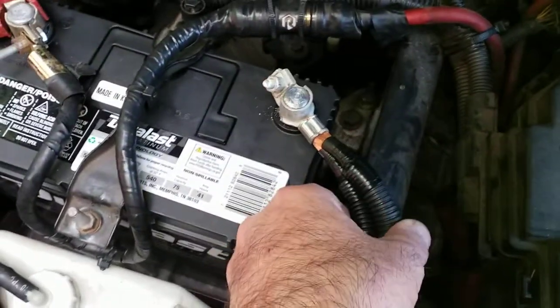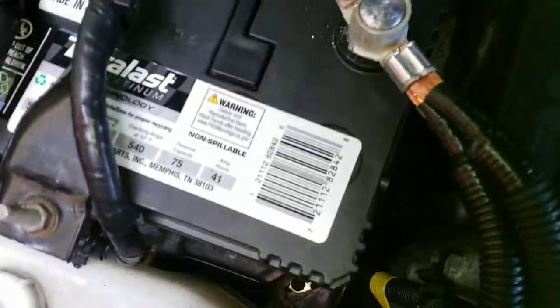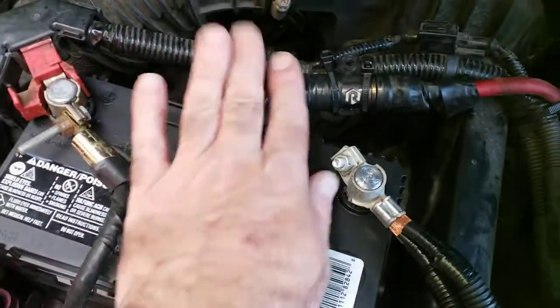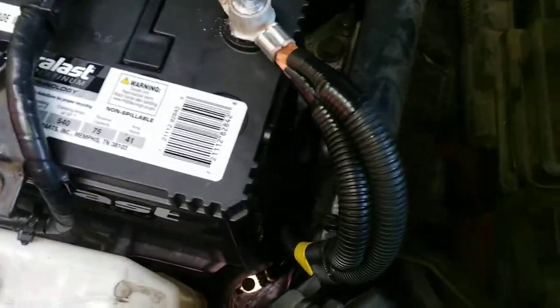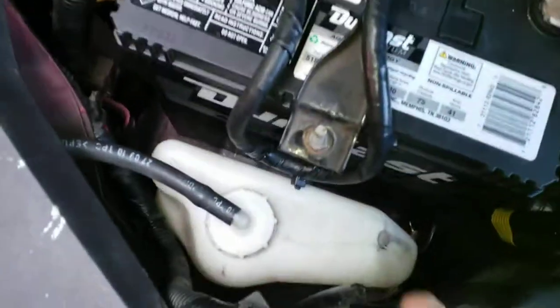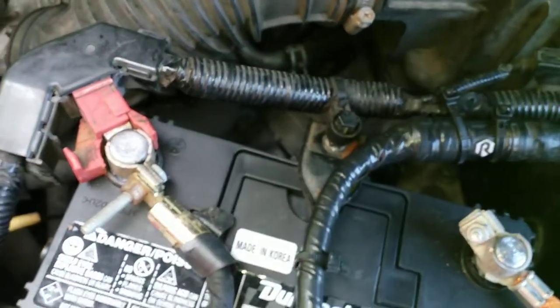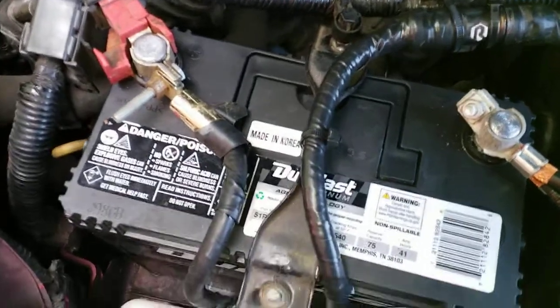This is the new cable assembly. Obviously, you disconnect the battery cables, both of them. Remove the battery. Ignore this because this is aftermarket stuff. That won't be there on yours. To remove the battery, this pops off. You loosen up this and the one underneath that, both 10 millimeters. Same with the battery cables.